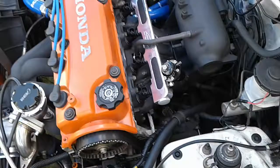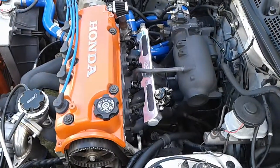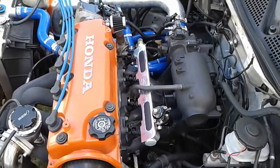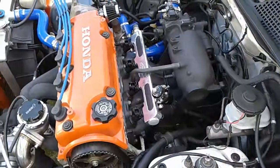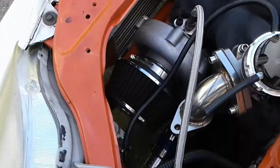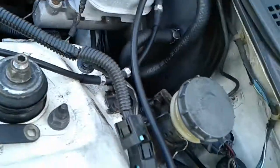The next video will be the car running, hopefully. I've seen a lot of videos using the Hondata with RC 750 injector settings and dead times, and those should work out good with these injectors. I'll set up the Hondata, put everything back together, then change the plugs and pigtails and go from there.